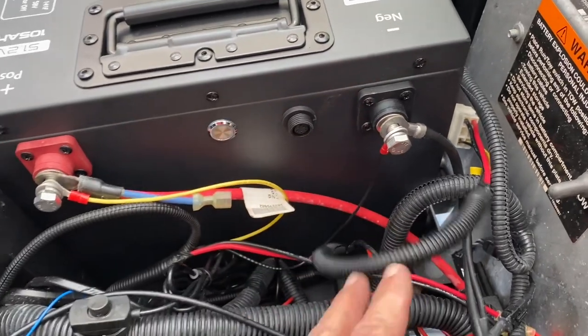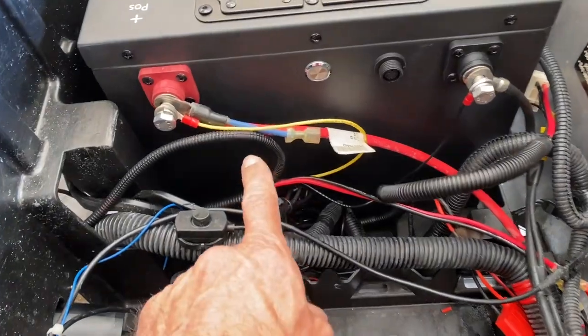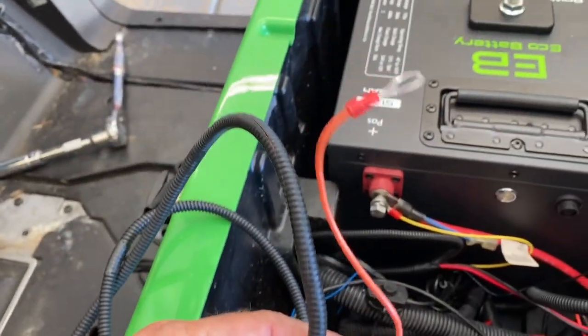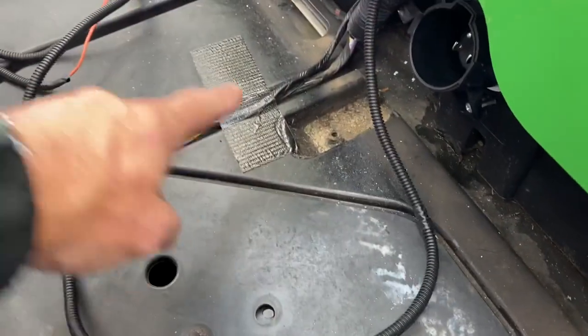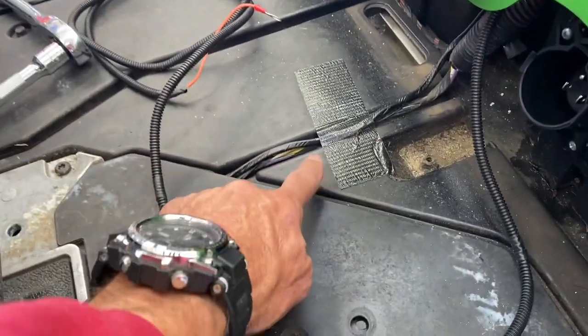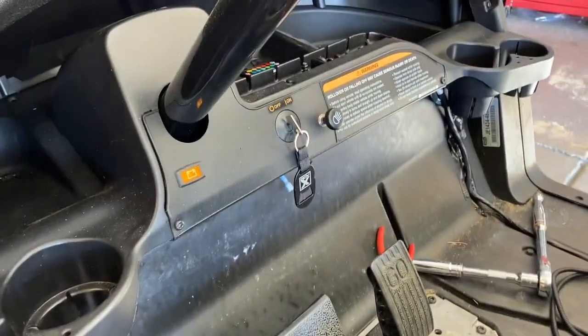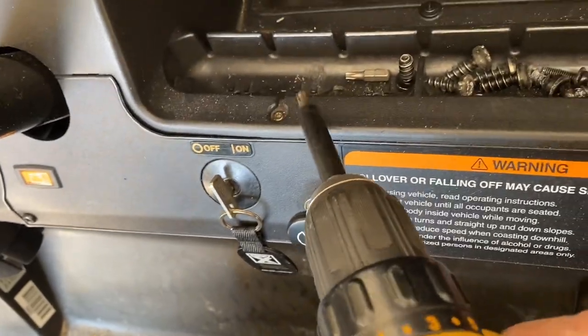Right now the battery is off; I just got the wires loosely screwed so I know where they're going to be — definitely not tightened yet. I still need to put the cable on for the battery charger and mount it. Right now I'm going to focus on this wire which is going to have your orange ring terminal. We're going to cut that off and feed it through the hole before I put this bottom plate on, then route it — probably do what the previous installer did and put a little tape to keep it in place. We're going to take this dash apart and mount our gauge. There's a T30 torx here, a T30 torx there, and right up top a T15.